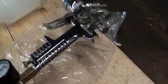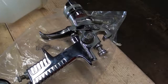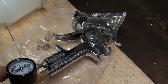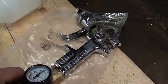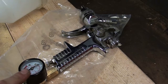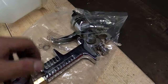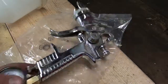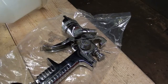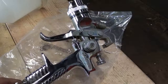Okay, that's my review for the Mastercraft Gravity Feed Spray Gun. It did a really good job at painting the car I was working on — I'm pretty happy with the results. It worked well with the compressor I had, not the biggest compressor, and that was one of my concerns. The main thing to keep in mind is get a regulator right at the gun — you can get these at Canadian Tire, Princess Auto, wherever. Keep it really clean especially after use — you've got to clean this thing meticulously to store it.